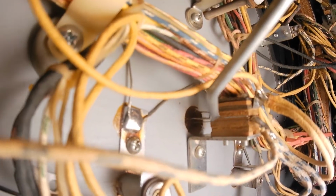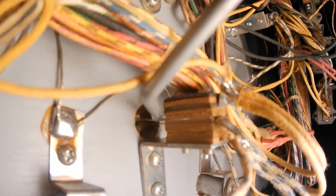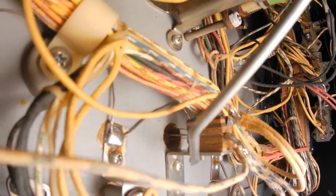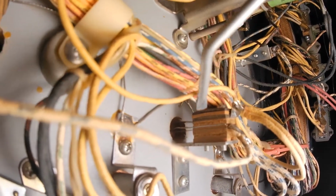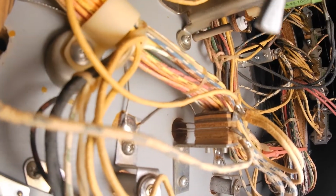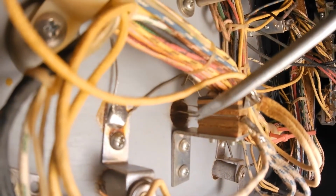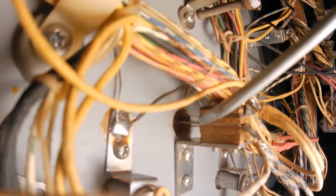But there's also, hard to see, another leaf here that puts a little bit of pressure on this contact to keep it away from the other one. This way it shouldn't accidentally touch. It's hard to see, but there is a tiny leaf right here, and you got to make sure that leaf isn't accidentally shorting against the contact on the far side.